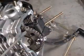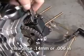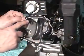Recheck for top dead center alignment and check valve clearance for specifications in the owner's or service manual. Install other components, replacing with new gaskets as necessary.